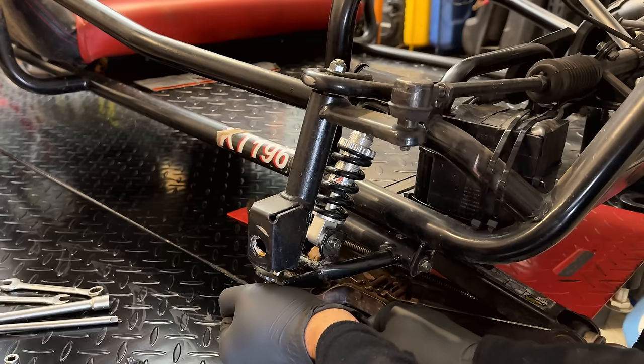It was too lean. And I'm not that surprised. I mean, I've had a lot of issues recently. Actually, the last three new carburetors I've purchased for a 200cc Honda clone were all too lean. I've had to drill them all out. And this one's no exception. We have a brand new engine with a brand new carburetor, and it was running poorly. It was surging. And unfortunately, a lot of that has to do with getting certifications that you're meeting emissions guidelines. And by doing that, you're actually causing the engine to not run properly. And a lot of these are probably going to end up in the trash sooner than they should because they're not running well. Anyway, that issue is behind us.